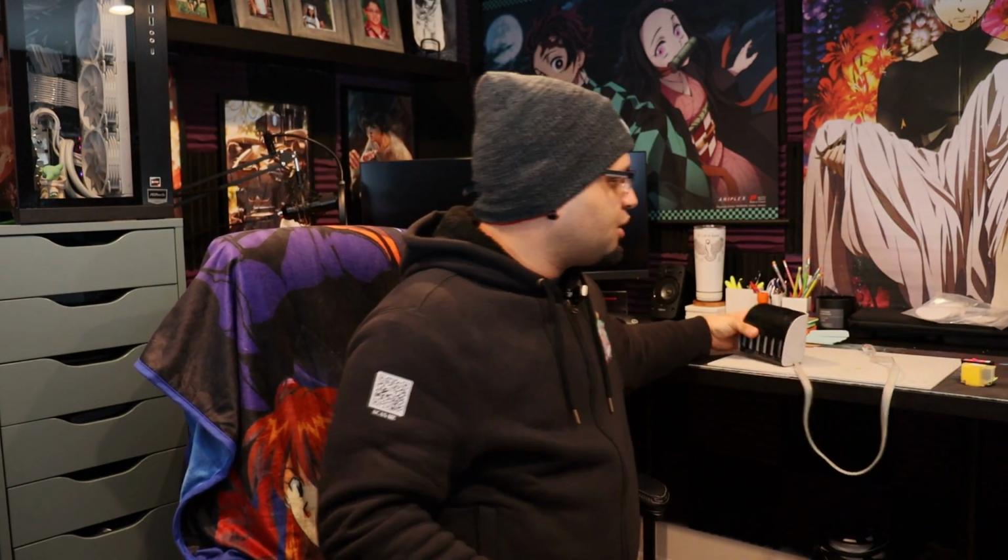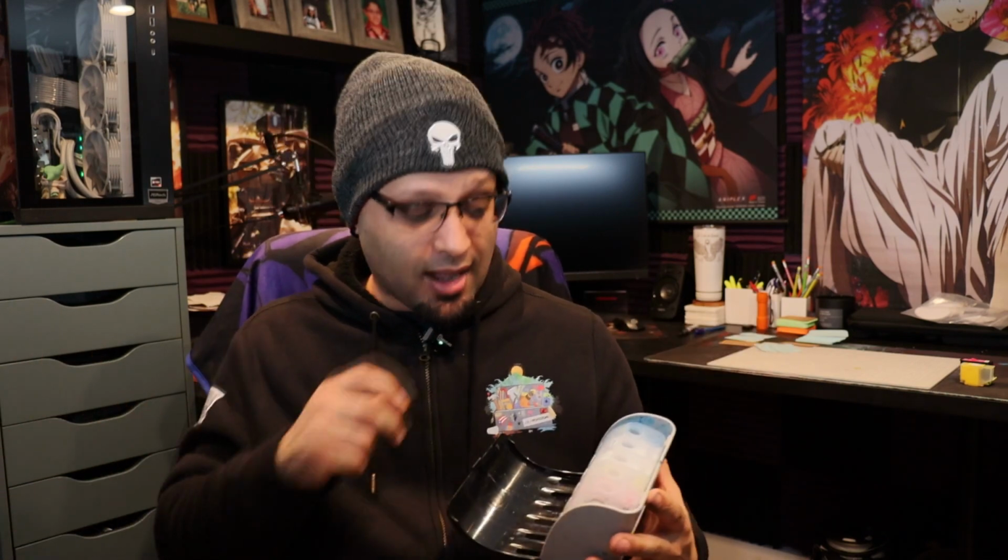Now, key number two, on your continuous ink system, when you're using it, you've got to let it breathe. A lot of people use the vents on the back. The only thing is, I noticed that when I do that, every time I'm going to fill it up, then I'm opening the big one to fill it. So what I do is I just keep that fill hole open every time I'm using it, and then if I've got to fill it, I just fill it up right there, and then I don't stop using it. So that's what I do.